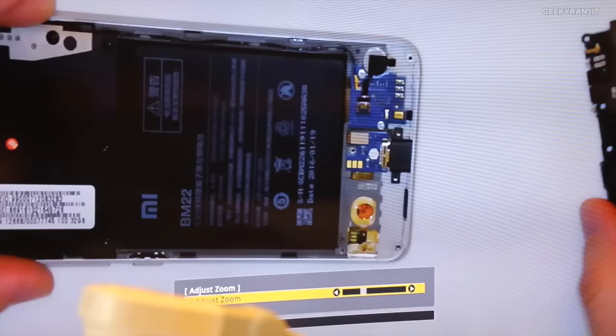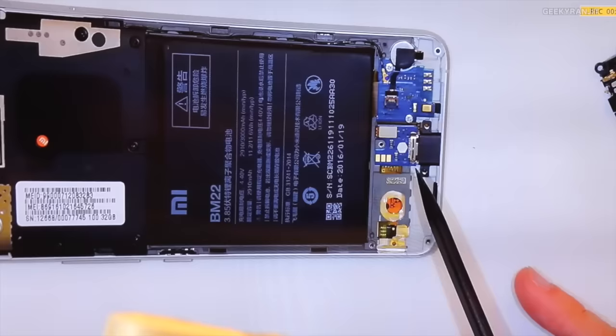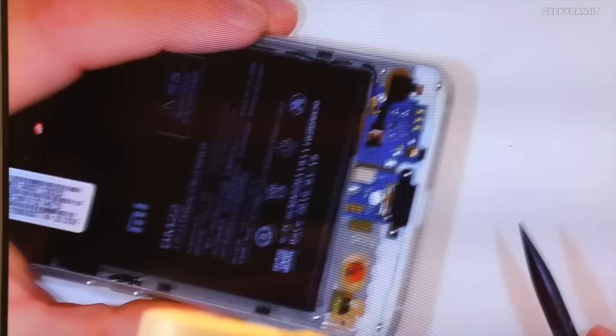Looking at it over here, this is our USB Type-C connector. What's interesting about this connector, if you look at it carefully, is that it's pretty well encapsulated. It's pretty well enclosed. The reason is it's the biggest opening that we have on the device, meaning it's relatively easy for water to get in there. So this is a pretty well encapsulated unit that is pretty water resistant.